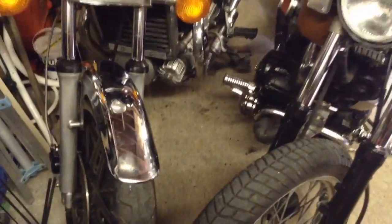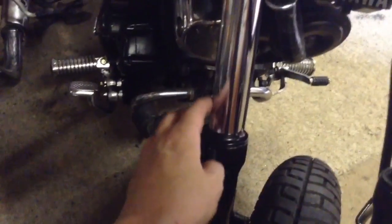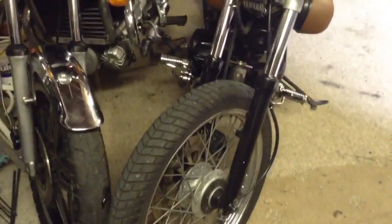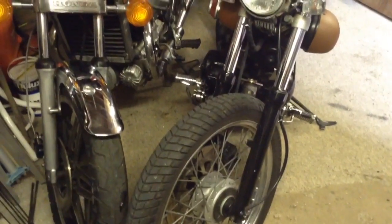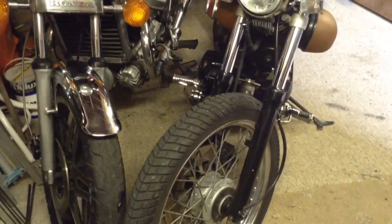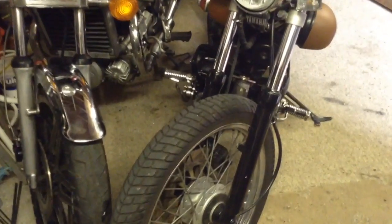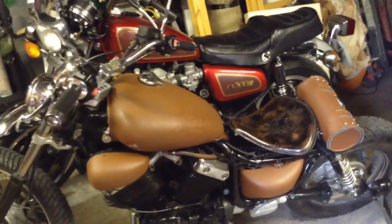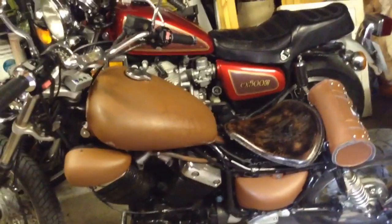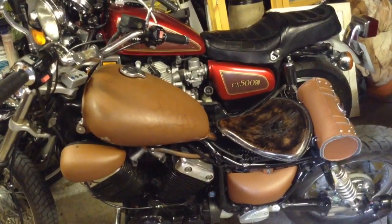What is a shame though, whilst I was down there getting the caliper back on, I saw some misting on the XV535 on the fork just there. So I guess that's something I'll need to have a little look at, just to see if it's some oil that might have splashed across, or some brake fluid, or whether it is actually fluid misting out of the seal there. But again, nice easy job to do, not particularly difficult. So both these bikes now pretty much done I think - just an air filter on the CX, final drive oil on the CX, and MOTs for both of them really.